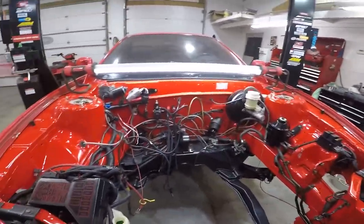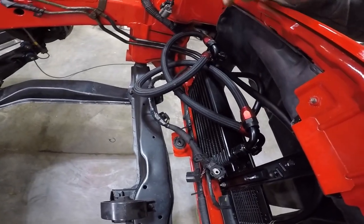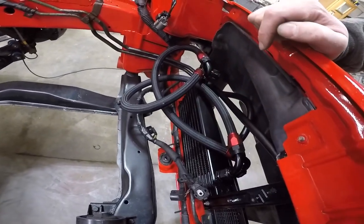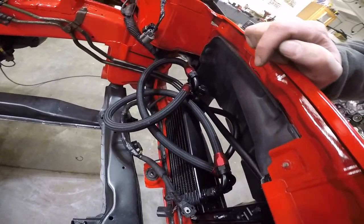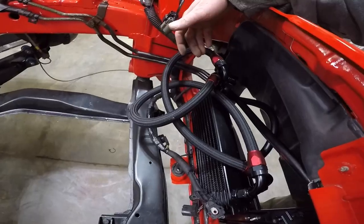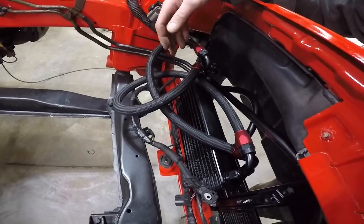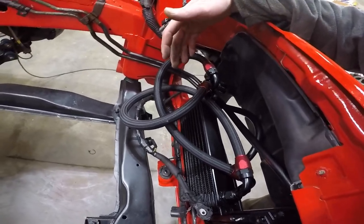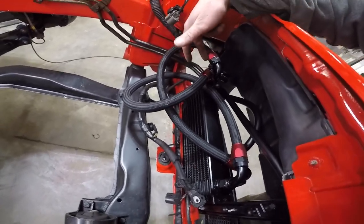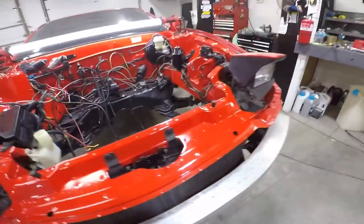While I'm waiting for Adrian to bring that bracket over, I'm going to take this oil cooler out because I want to drain it and also remake these oil lines because I think they're leaking. I think it's just these cheap Chinese fittings. This is just the Amazon oil cooler - I figured a cooler is a cooler - but the fittings are garbage. They're so soft, so cheaply made. Let's get that out.